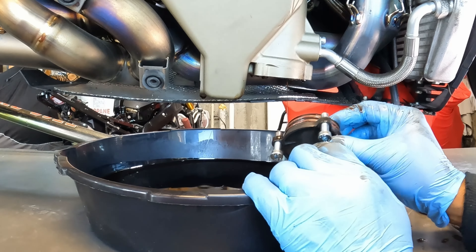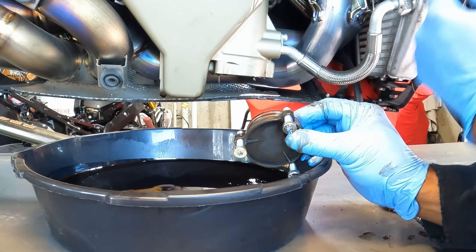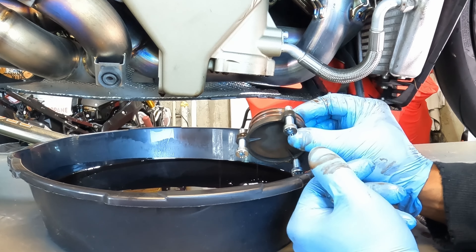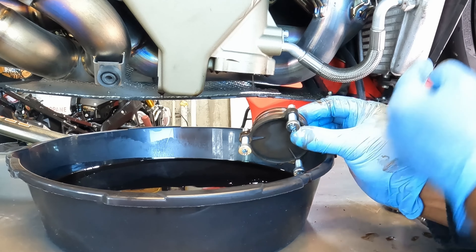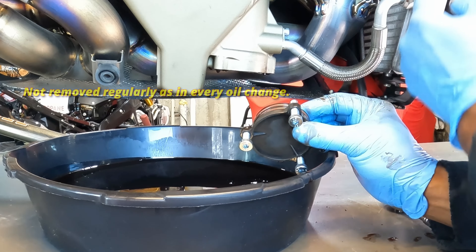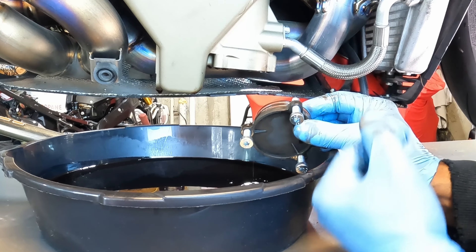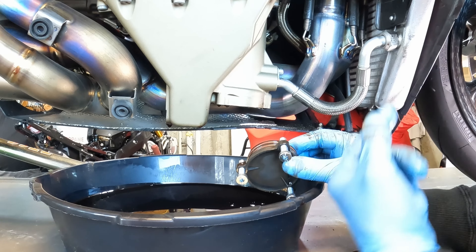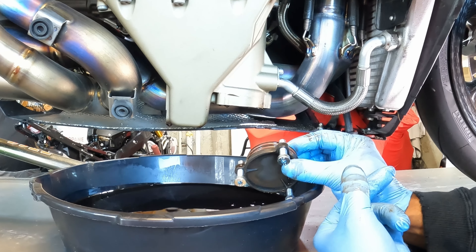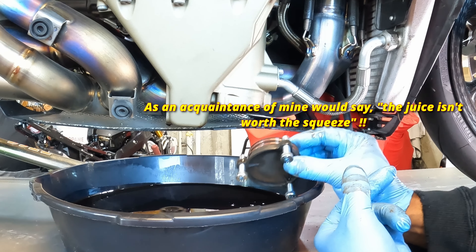Now while that's draining, let me mention the oil cooler. I often have people ask me: do you drain the oil from the oil cooler? The answer is no — I don't know any certified techs that drain the oil from the oil cooler. There is no drain plug in the oil cooler, and these high pressure lines are not meant to be removed. There's a large nut and a fastener with an O-ring and screw that holds it to the oil pan — we don't need to change this. The amount of oil left in the oil cooler during an oil change is negligible. If you really want to change it, go ahead, but you're creating ten times more work for yourself and it's largely unnecessary.